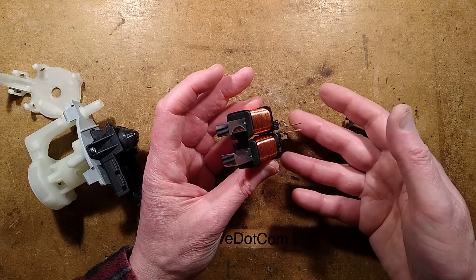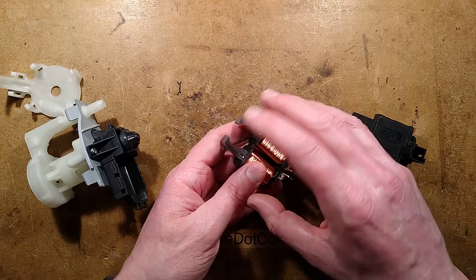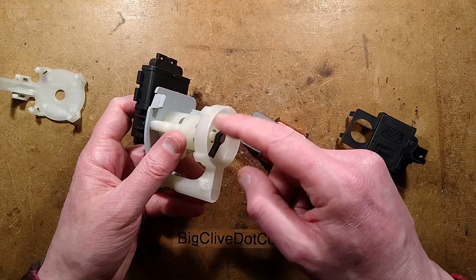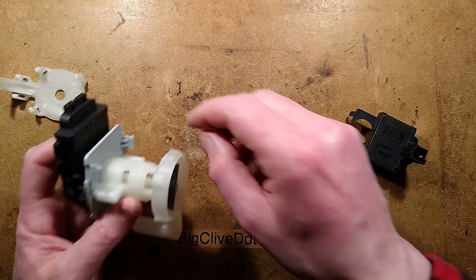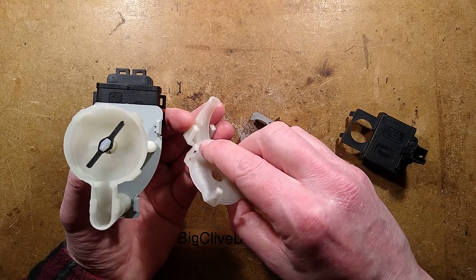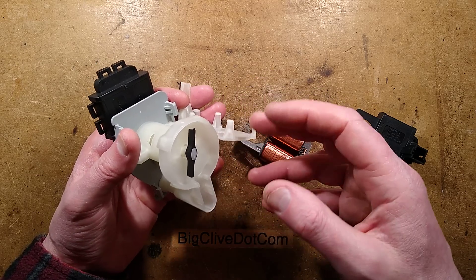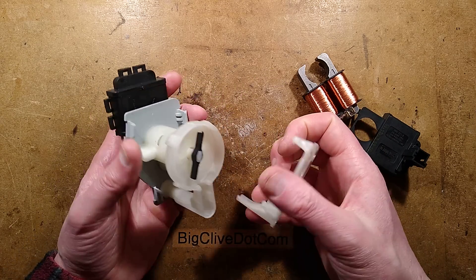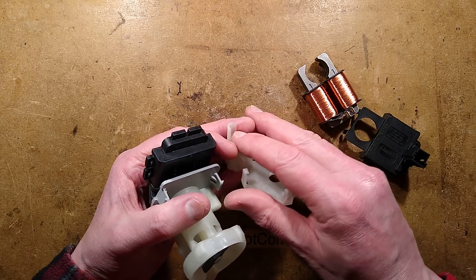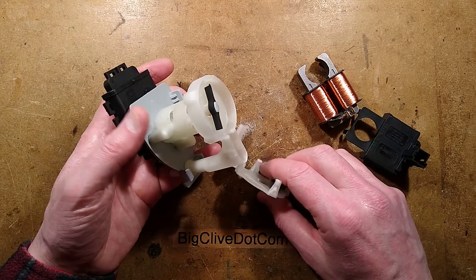This operates at mains voltage — 230 to 240 volts. It generates a magnetic field, and because it's alternating and there's that magnet in there, it gets the rotor spinning. When it spins, it throws the water outwards, whichever way it spins, using this little scoop. I doubt this is an efficient design, but it's optimised for reliable operation. It throws the water out against this curved channel, which diverts it up a pipe to the top of the machine where it goes into the water container.